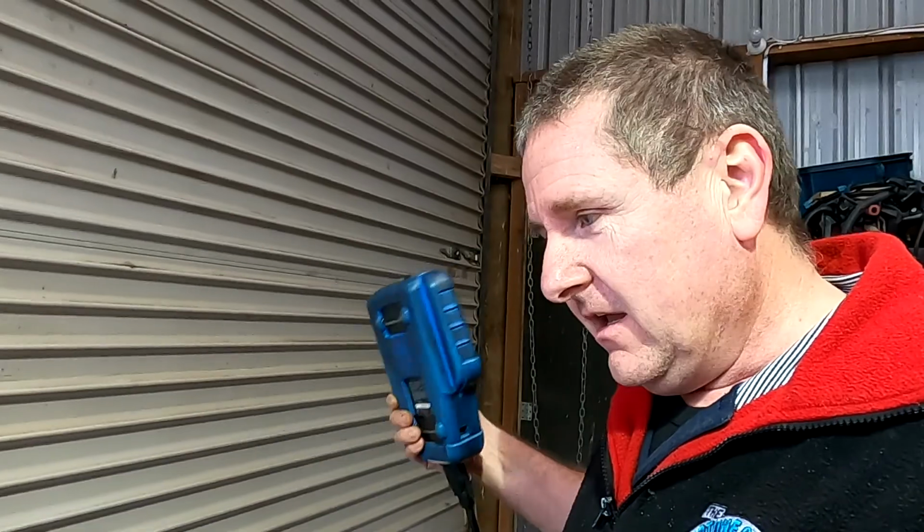Just like on the one that I did for the auto, on this one I check with the scan tool that the computer doesn't pick up any fault codes or any existence of the transmission. This transmission's completely unplugged, not connected at all. The engine's been run like that, and again, no fault codes related to the transmission in the ECU.